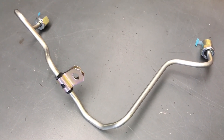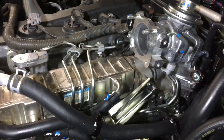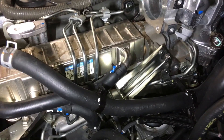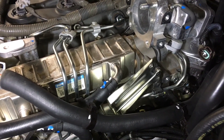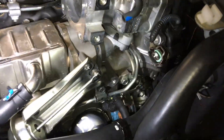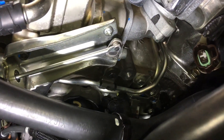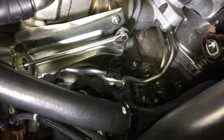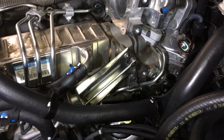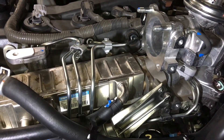There's one other really important bolt on another component that could cost you nearly a thousand dollars if you don't remember to put it in and tighten it up. Now let me show you a few tech tips with the fuel pipes. The fuel pipes hold up to 160,000 kPa at maximum pressure, so they can't be leaking. On the number four fuel pipe there's a clamp — people forget to put that bolt in. You can actually see it right there. Don't forget it. Slow down, double and triple check everything.